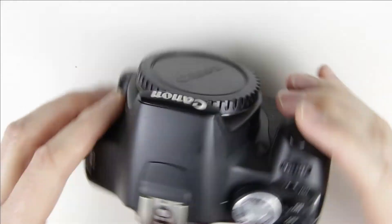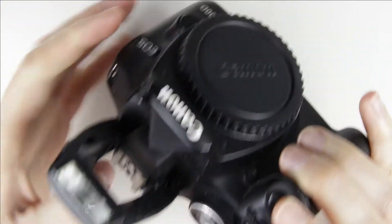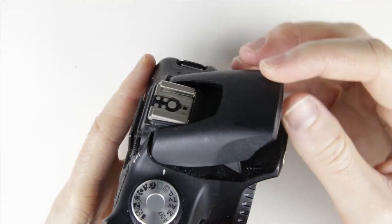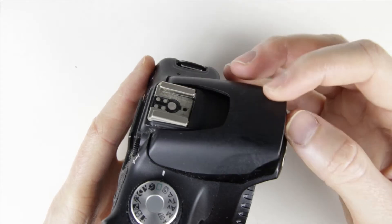Turn the camera off and on and try to open up the flash. When the camera tries to open up the flash, pull the flash upwards and open it. As you can see, the spring can pop up the flash. One of the axles has some water damage, got rusty and needs to be cleaned.